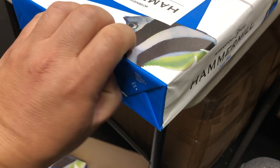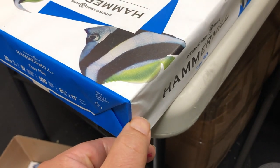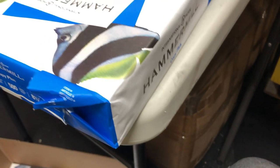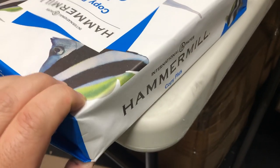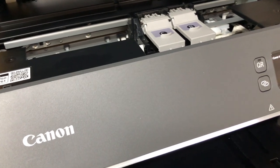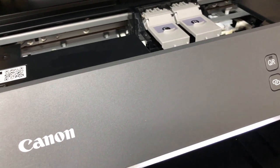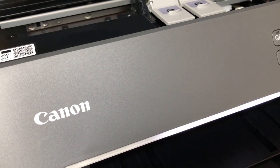The second way is simpler: take a ream of paper. Each refill, you can print about half a ream of black, so just take a ream and separate it into two halves — whenever you finish that half, refill the black. When you finish the whole stack — every two half-stacks — refill the color. Third, you can refill regularly — every week or every two weeks, just add a couple drops. And the fourth way is just keep an eye on the printout: if it's faded, add ink.